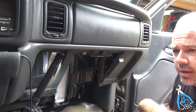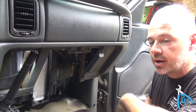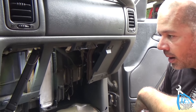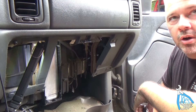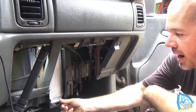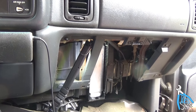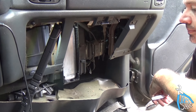Now it's time to glue it all back together. A quick post-mortem recap: it actually was not a very intense project. We used a 7mm socket, a 5.5mm socket, a 13mm socket, and the oscillating tool to cut open the window here, plus whatever your weapon of choice is to hack through the dash brace. If you were trying to do this in a hurry, this is probably a 30 to 45 minute job — it was not bad at all. Don't be scared to tackle it. Don't be scared to hack on that window — cut that thing open and give yourself plenty of room to work. Joe had some plastic bonder sitting around, so we're going to use that to glue it back together. That's it — we got AC.